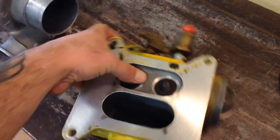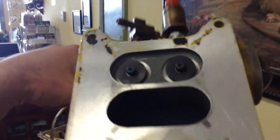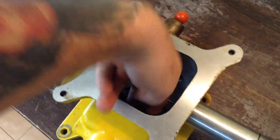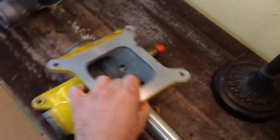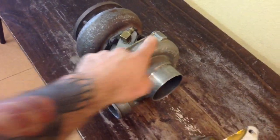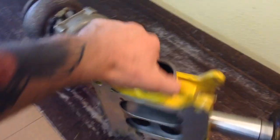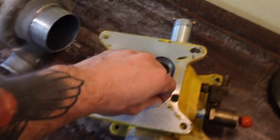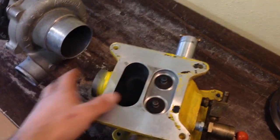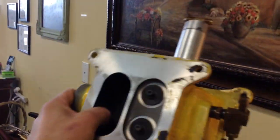So your intake manifold's down here. These are those valves we've seen earlier. They're kind of just floating freely there. They open and close. And how that works is when you are not under boost, your air-fuel mixture is just going to be sucking down through those valves because there's vacuum and not boost. But then when you slam on the gas and you start getting boost going through here and coming in, it's going to pressurize your intake manifold. And these valves are going to slam shut because of the boost pressure. There's no springs, nothing in there. They just float freely. They operate off of vacuum and boost pressure only.